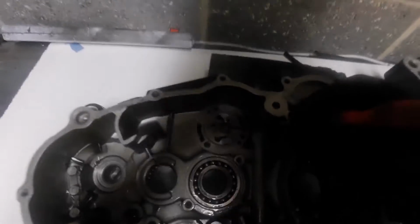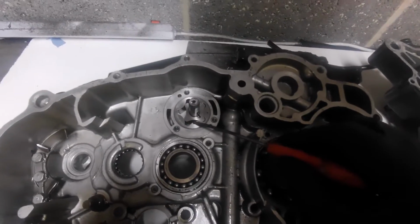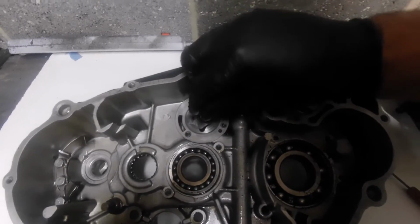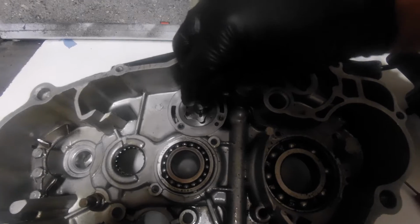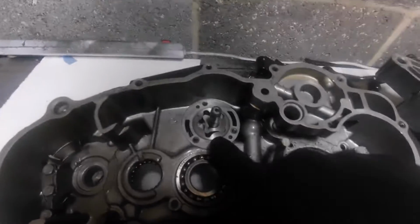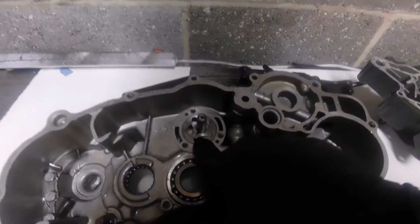Right, if we can zoom in for a bit of detail, if we watch at this point here, we're going to start this here. As it's turning, it's getting bigger. Forget all the rest of it. This bit here is actually getting bigger, as is the next one behind it. It comes from nothing to bigger, as do they all. So that means that this port size is constantly getting bigger, which draws suction, if you like, drawing the oil up into here.